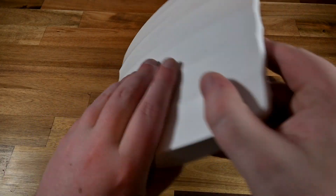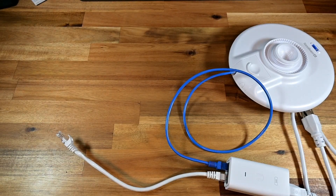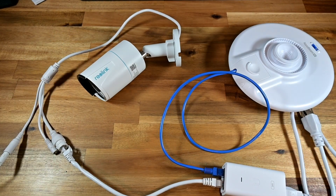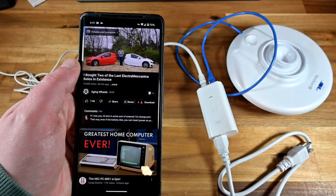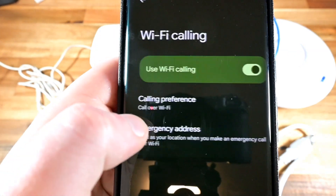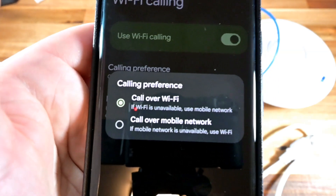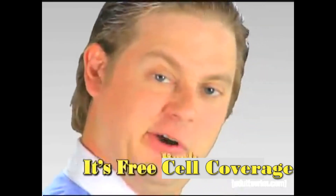If you don't need extra ethernet ports, wifi range extender devices often have an access point mode too and are a little cheaper and smaller, but performance is often worse than a used older mid-range wifi router or a new low-end router. You can also buy dedicated access point devices from companies like Ubiquiti or TP-Link, which typically perform better than cheap extenders. If you just want to hook up a single wired device like a security camera, computer, or IoT device, you can attach it directly to the wireless bridge's PoE injector. And don't overlook wifi calling — if your cell provider supports it, you can send and receive calls and texts over wifi, which is great if your building has metal or concrete walls blocking cellular signal, or if you're in a remote area with poor service.